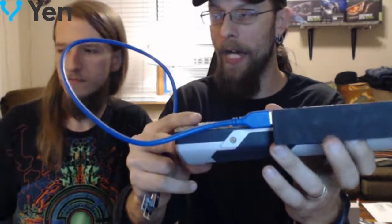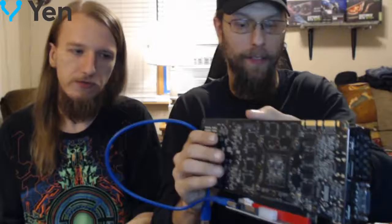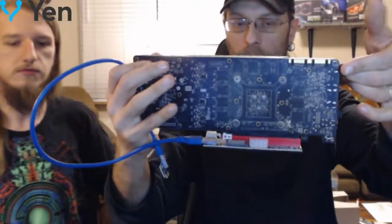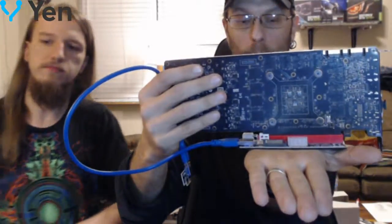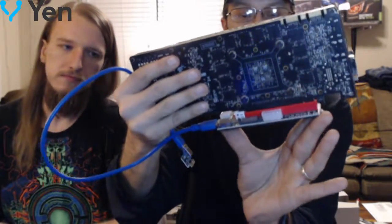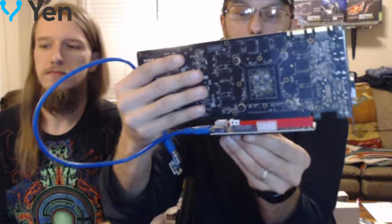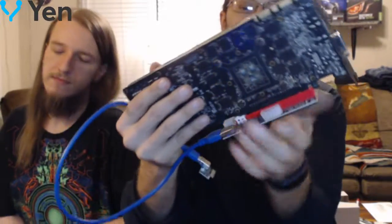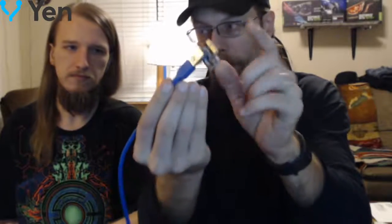If you look down here, there is foam on the bottom. Now if you're hanging the cards, it gets warm — a lot of heat is produced by your mining rig — and what ends up happening is the glue comes undone and it peels off. Don't be surprised if it falls off, especially if you're hanging your graphics cards with zip ties. If you set it down onto a surface, you won't have to worry about it. But if you're securing them, don't secure them too tightly or you're going to crack the board, and if one fails it'll be a pain to rip it all back apart. So choose your locations for everything wisely, and choose which PCIe by-one connector you need for your motherboard.